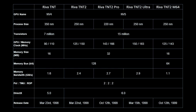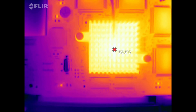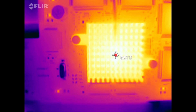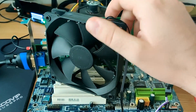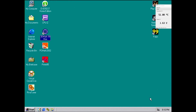The ELSA Synergy 2 is clocked at 125 and 150MHz for core and memory, which is equivalent to the standard TNT2. Before I start any benchmarks, I checked this passively cooled card with a thermal camera. The chip produces so much heat that you can no longer touch the heatsink for more than a few seconds. The highest temperature I could measure was 62 degrees on the heatsink — the chip itself is probably a few degrees hotter. This card probably should have been equipped with a fan, but it looks like ELSA tried to reduce the cost. For my tests, I just placed a case fan next to the card to blow away excessive heat. The temperature immediately starts to drop and after a few minutes it levels off at around 38 degrees.